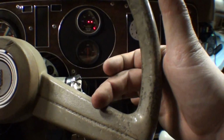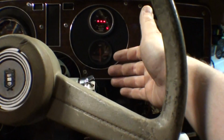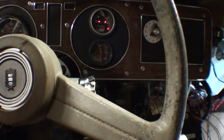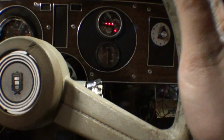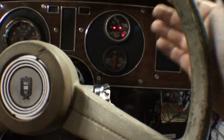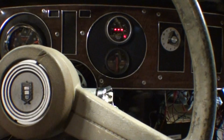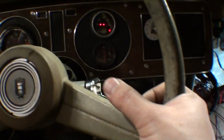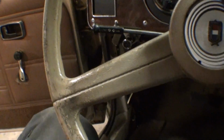If you are too shallow, you'll never get to the second bump. Your next bump is going to be way too far. And then if you're too deep, you're going to go way past it, and you're going to deep stage and turn off your first bulb. So most people want to bump 2-3 times in. I would say 3 is a pretty safe bet. You're always going to get your second bulb at least. And then you just don't touch the bump at all. You just let go of your trans brake button, however you set all that up.